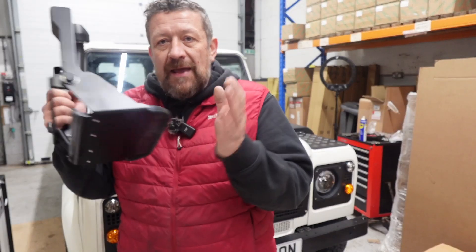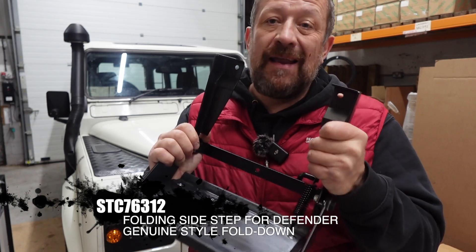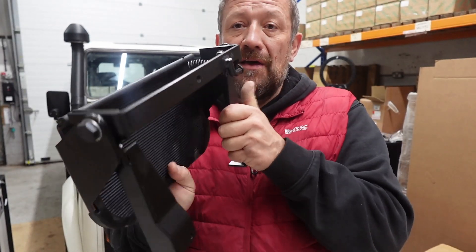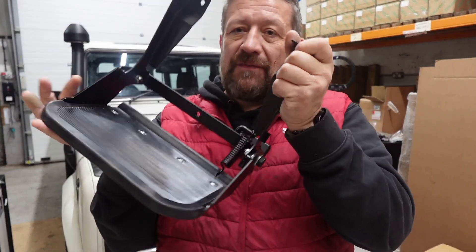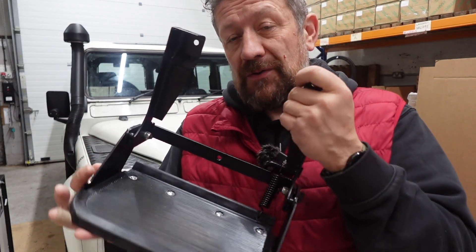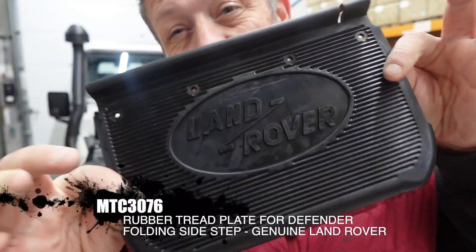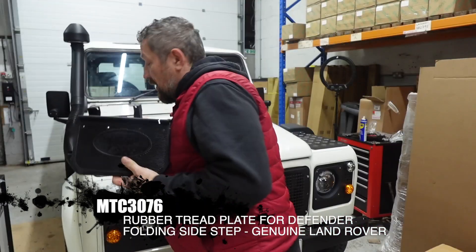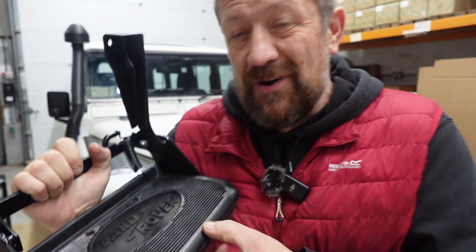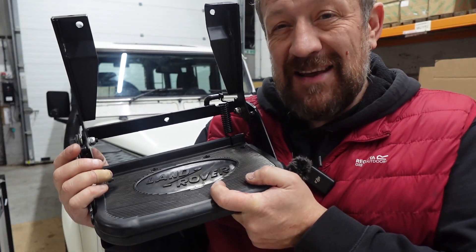Do we go for a traditional side step? What I've got here is an aftermarket side step from LR Parts. It's massively cheaper than a standard original Land Rover part, but is there really that much in it? It's a fairly basic piece of engineering — just two pieces of metal connected with bolts and a spring — and yet this is £75 cheaper than an original Land Rover part. For about just over £40, I think these are, and you get all the fixings and the support bar as well. You can buy an original Land Rover rubber piece — they're not cheap — but when you combine this with an aftermarket step, because they're exactly the same size, you can take this rubber off, drill out these rivets, and just replace that rubber with a Land Rover one. You've pretty much got what I would consider to be a very good replacement and a very original-looking part for less than half the price of one from Land Rover.